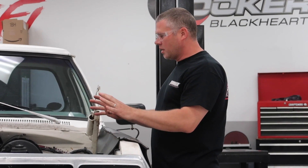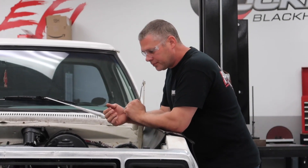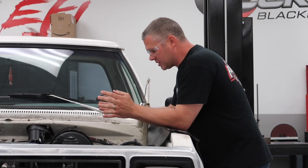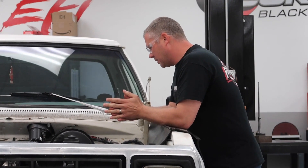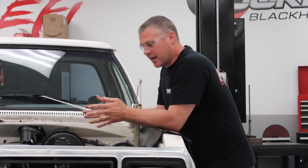The system we've come up with — we wanted all the parts to play together nicely, so we started with the motor mounts. Typically, other components that you buy from other companies place the motor so the transmission bell housing is in the same position as factory, and that gives you a bunch of problems — it creates more problems than it fixes.